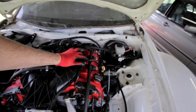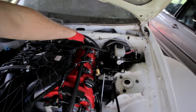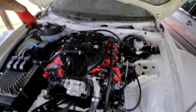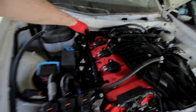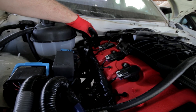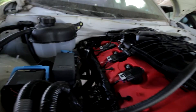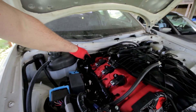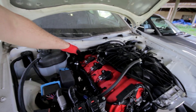This whole cylinder head then gets issues with oil gunk buildup. The only way for positive crankcase pressure to escape is out of this elbow, where there are no filters or anything — it's just a big open elbow — and it's going to throw all those vapors back into your intake. You want this constant cycle going, and in order to do that on the earlier pre-2013 motors: you can't simply get this elbow or CCV valve from the later 2013s, as far as I know it comes integrated in the valve cover on the later motors. So it's easy enough to grab it with some pliers, pop it out, drill it out, and clean it up so you don't have that buildup. If you have a mid-2013 or later, you'll see it's got the bigger holes — you don't have to do anything with that.